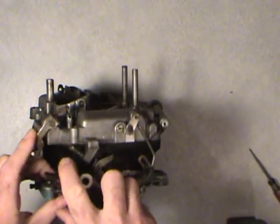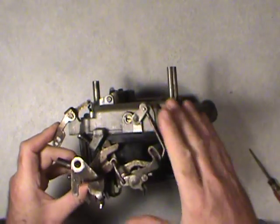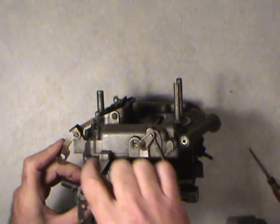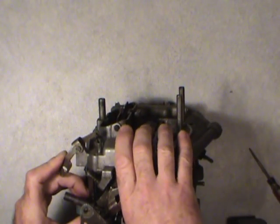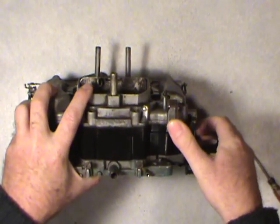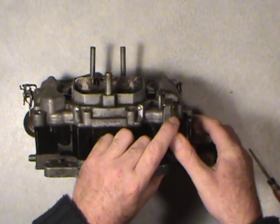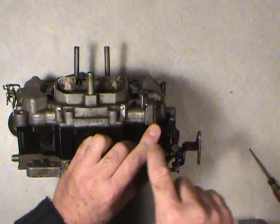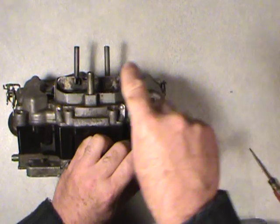It's got an offset on it. It's not exactly straight in line, the actual link. It's got a bit of a curve to it, if you will. So you want to make sure that when you're looking at this thing, when you reassemble it, that you get the letter S. It's an English language. You might be viewing this from other countries, but you're looking for a shape like this as viewed from the front of the carburetor. So you start here and it's like that.